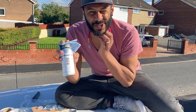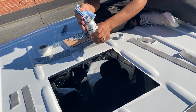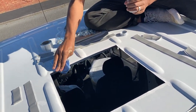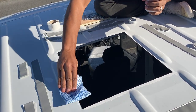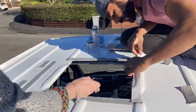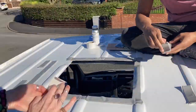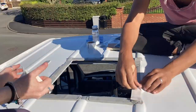What have you got there then? This is the most expensive primer in the world. I wasn't joking — that small 250ml bottle cost more than 40 quid. After reluctantly applying it to the roof, we started sticking mastic sealing strip on top. This stuff is like a super sticky, mouldable putty, but more importantly it's completely waterproof and never sets hard, making it perfect for this job.